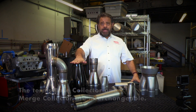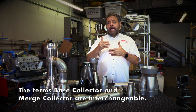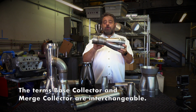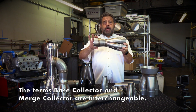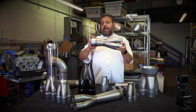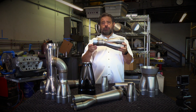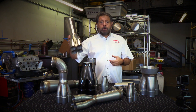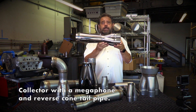Typically we talk about the base collector, which would be this part of the collector, and then we have the various outlet strategies. This being the most common, which would have a transition and an exhaust ring. This type of configuration is what typically would be used in a road-going application where you actually have an exhaust pipe and mufflers or something that goes underneath the car.